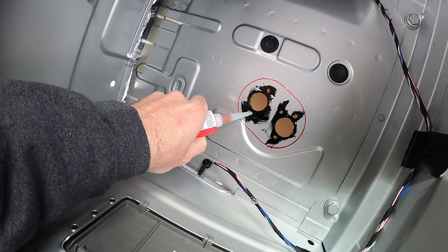The exhaust is the side not next to the fuel line — or the opposite side from where the heating duct comes out. Mine is facing the back of the van. Here is the exhaust line, and I have tighteners to secure it in place. This attaches to the SBAR heater, and this one attaches to the muffler. I'm using a T30 Torx wrench to clamp everything into place — nice and tight. It's going to run straight over to there, unfortunately right in front of the side door, but it's not long enough to make it all the way across.